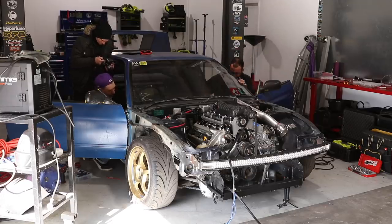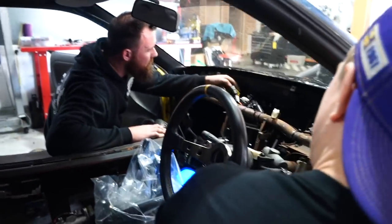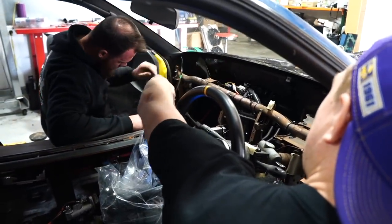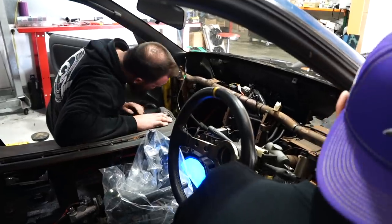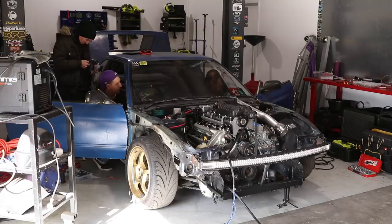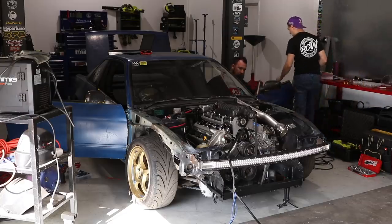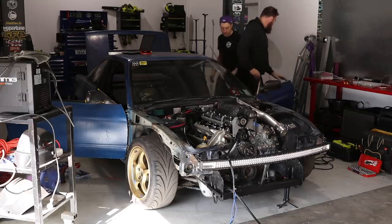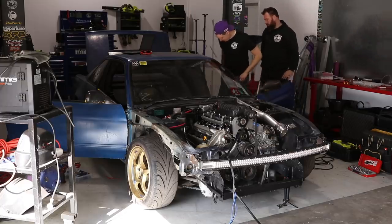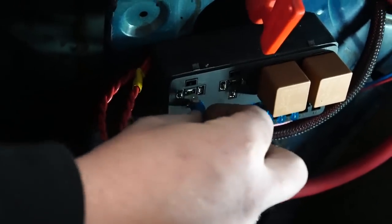So where is your fuel pump trigger? Which one's that? Follow the one from your knee. What color? Red. So red is fuel, white is fans for the back. Is it positively switched or ground switched? It's positively switched. It's probably ground switched by the ECU. What's the second pin? Is that just the fans? Yeah. It's normally ground switched. Okay, well that would be why the fuel pumps aren't on. But what we can do is just bridge the relay out and see if it'll run. There we go. Yep. Fuel.